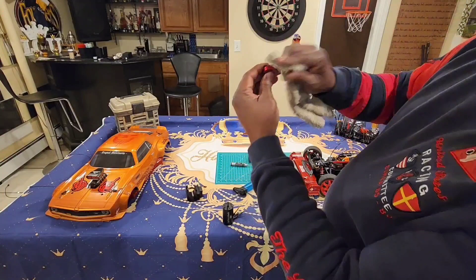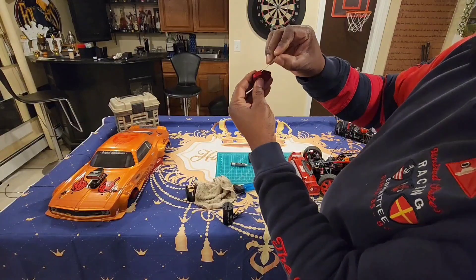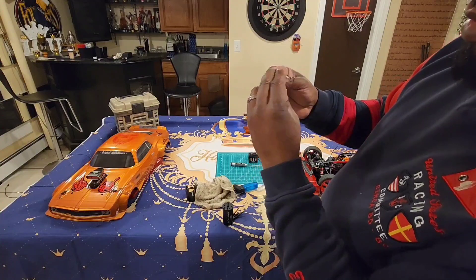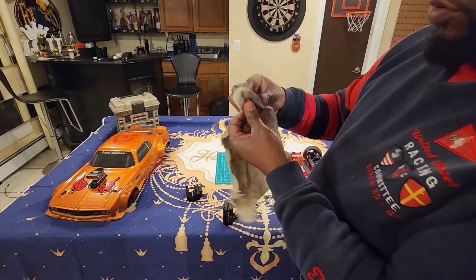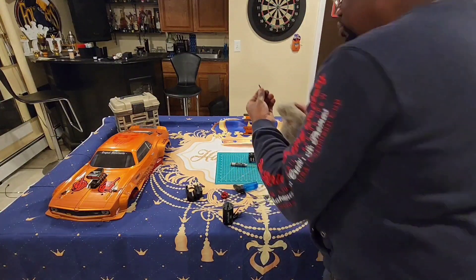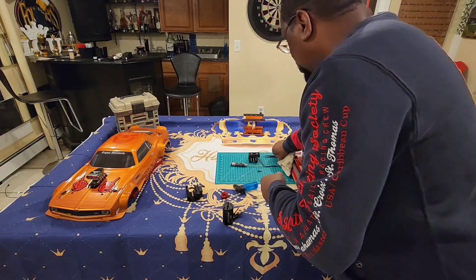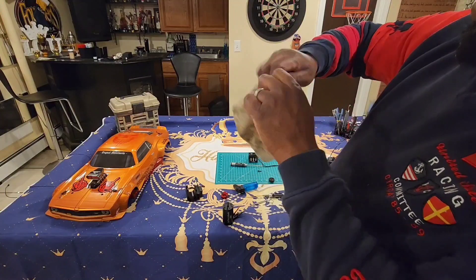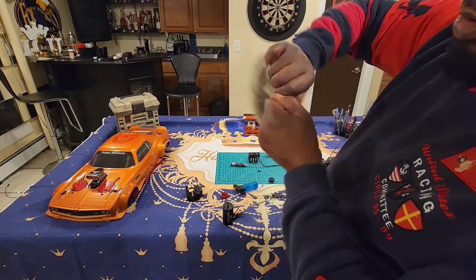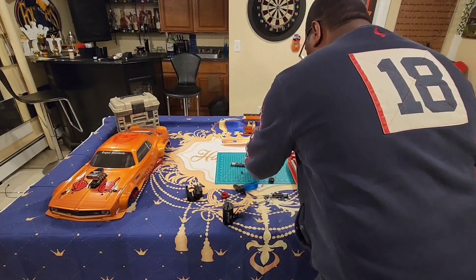What I'm doing right now is trying to get all my parts cleaned off pretty good. Get all of that cleaned off, then take your screws and clean those off too. You don't want to put your screw in and out repeatedly — try to clean as much of the screw lock off the screws before you apply more and screw it back in. You don't want to tape it up too much.